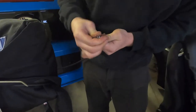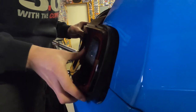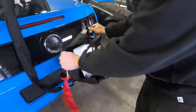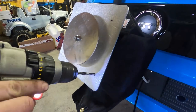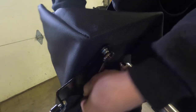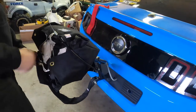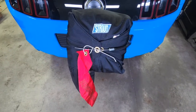That looks pretty trick. Now I'm packing the chute temporarily. I'm going to cut the cable to length here, and then I'm actually going to unpack it and hook up this cable bracket that bolts to the back of the chute mount — that's a Motion Race Works piece. It just holds the cable so that when you pull it, the sheathing of the cable can't move, which would cause the chute to fail deployment. It's just a safety measure to hold the cable sheathing in place so the inner cable moves freely.